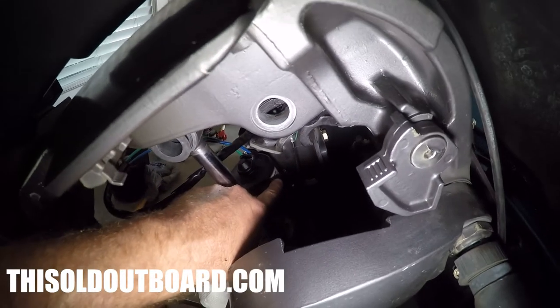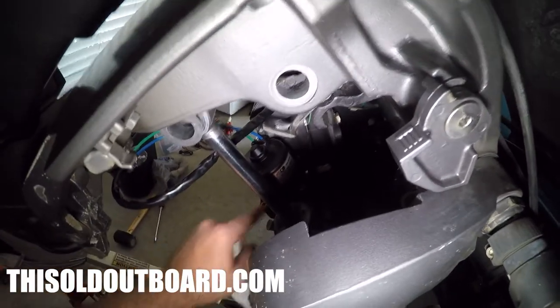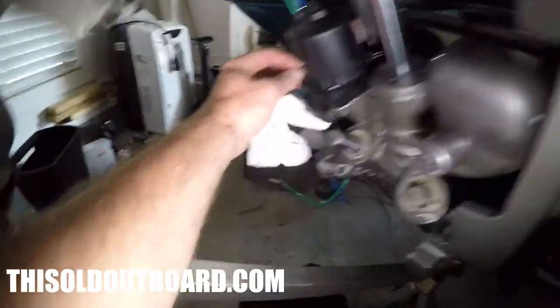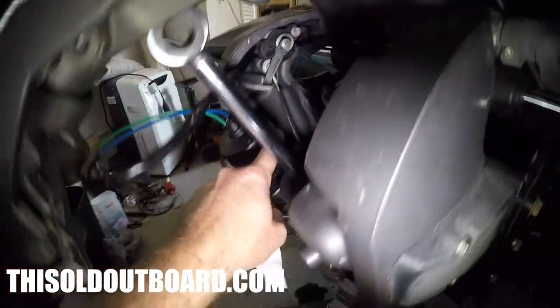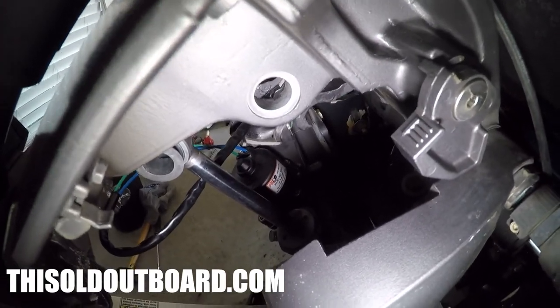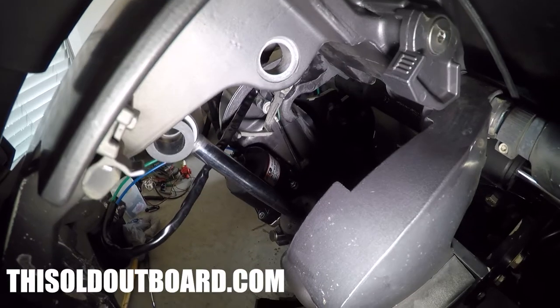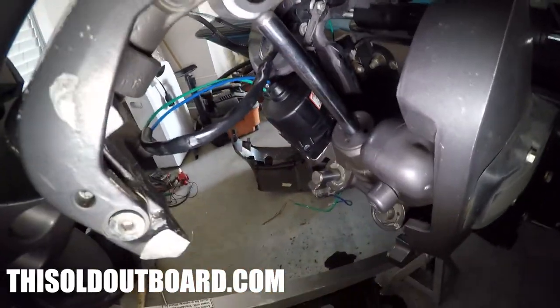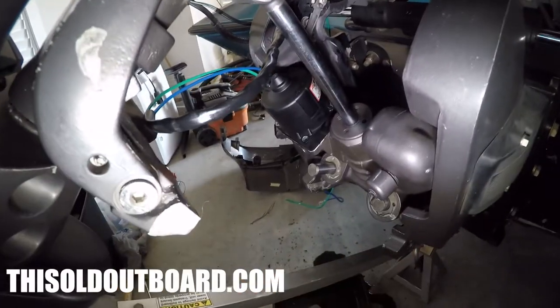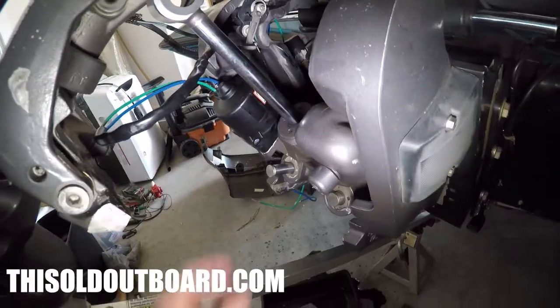I've gotten it finger tight all the way down to the flange — it doesn't really move. Get everything finger tight. For that back corner screw, take your time getting it finger tight — use the extension without the ratchet and spin it until you get it all the way down — because you don't want to strip the threads in these housings. The whole system is about three to five hundred dollars on eBay, so take your time. This is the part you don't want to screw up.